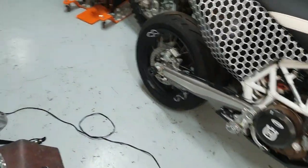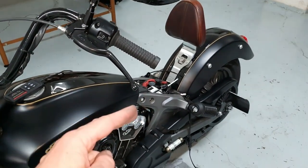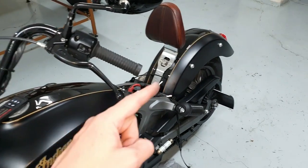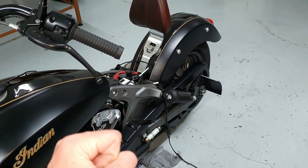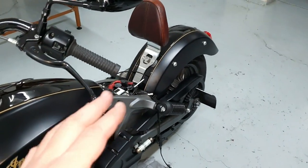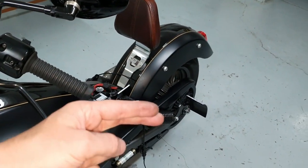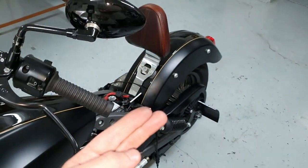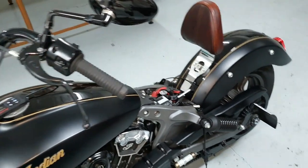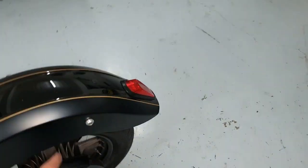Were the bearings bad? Yes. When you put your finger in the hole, when you try to turn the bearing using your hand, it's supposed to turn. These didn't. I mean, I could really try and they turned. The grease was absolutely old school, really. I mean, the grease already was on pension fund, okay? And that was front and back wheel bearings.